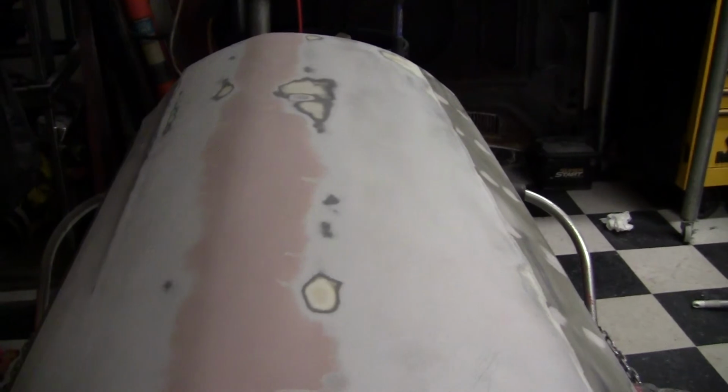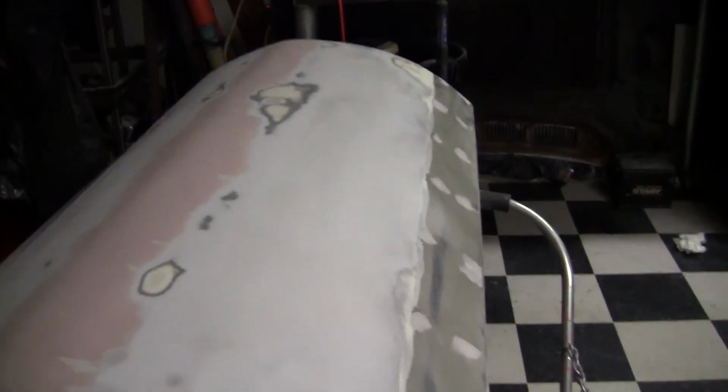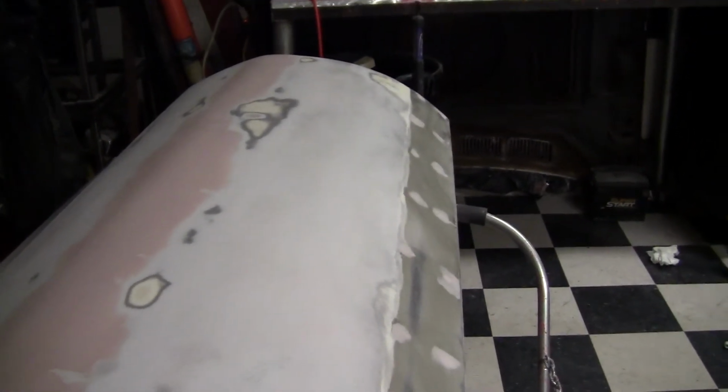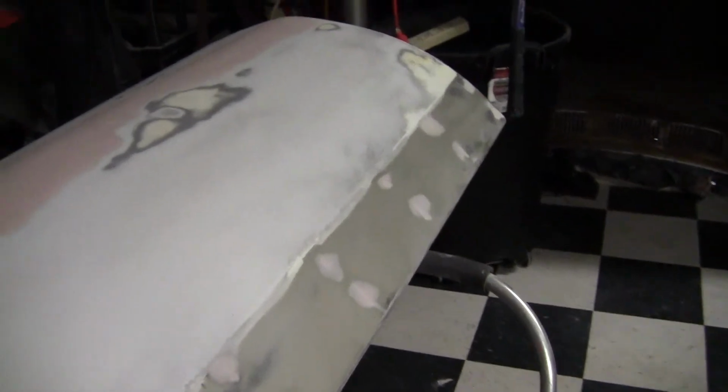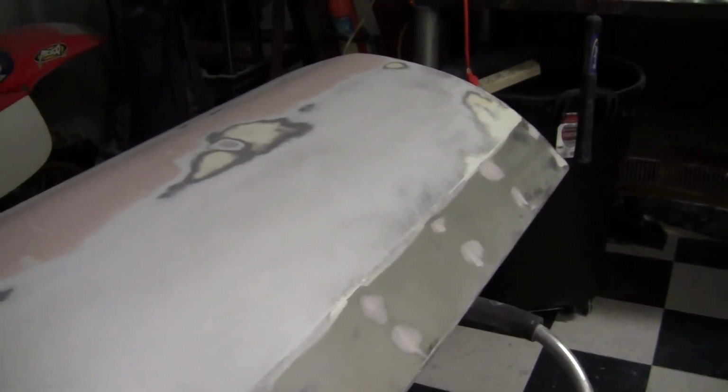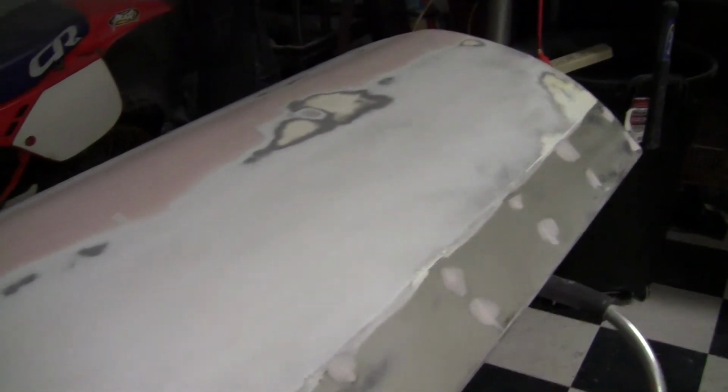And then what I'm going to do is primer surfacer the whole door, and then put a guide coat on the whole door, which is when you spray black primer spray paint or whatever, and do your block sanding, and you'll quickly find any low spots and even high spots too. So that's where I stand. Check me out on the next video.